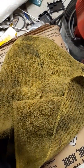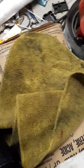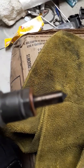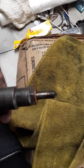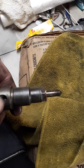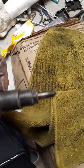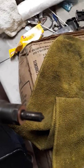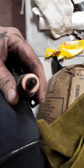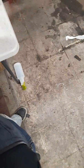One of the things to check is your tip. If you want to know what kind of nozzle is on there, there are numbers on it, but you can't see them because of the carbon. What you're supposed to do is use a sonic cleaner — put the injector tip in and it'll clean off all that carbon so you can read the numbers. If you try to use anything abrasive on the tip it'll rub the numbers off, but with a magnifying glass you can look right at the tip and count how many holes are in it.